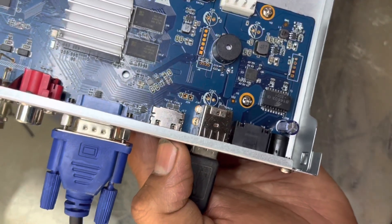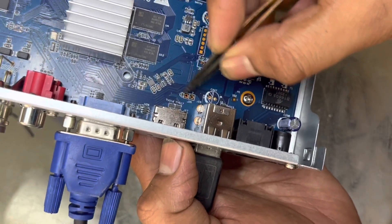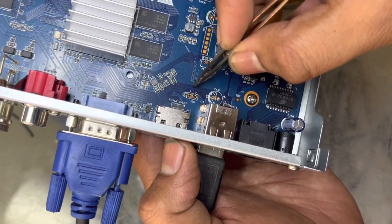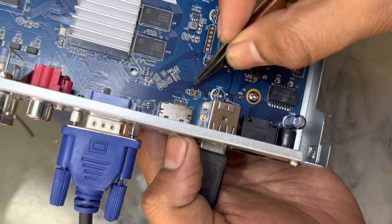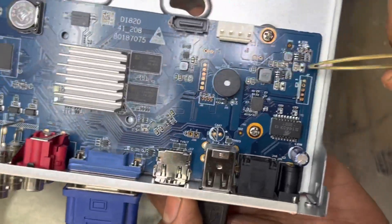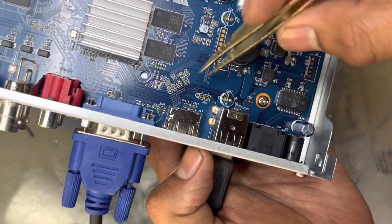The second thing: if there are more than one set of similar-looking points, you have to check which one has three volts on its side using a multimeter. In this case, we don't have any other two-point sets that look the same, so there's no need to check — we will go straight ahead to shorting these two points.